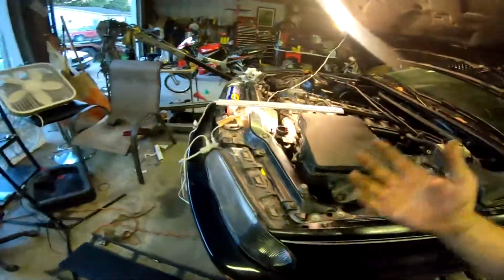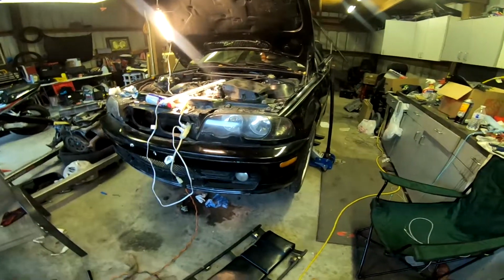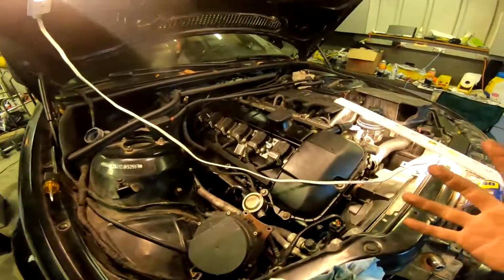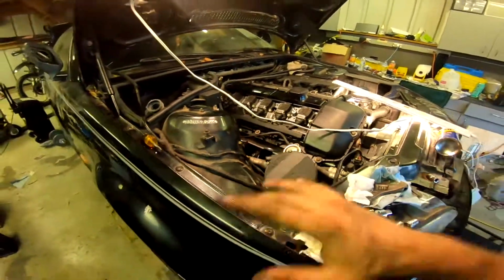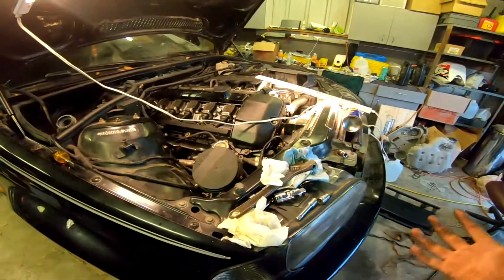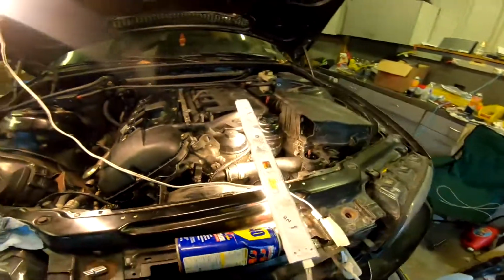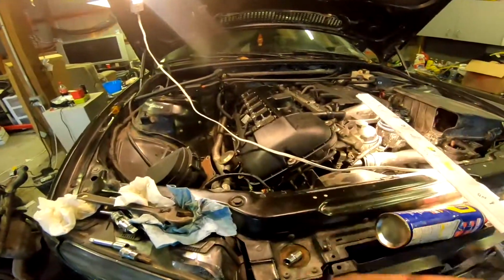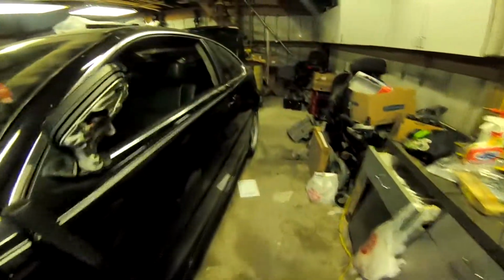It starts. That's great. I'm so relieved. Well, it runs. Honestly, just button everything up and see where that ticking is coming from. It is a little bit weird for it to be ticking like that. But it could be just the incline and not enough oil getting to the lifters. The lifters, obviously, have been sitting, not primed, so that's definitely a sound from the lifters, but they all went in perfectly, so we should have zero issues there. It doesn't sound like it's knocking or ticking hard. It just sounds like lifter noises.